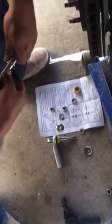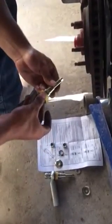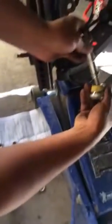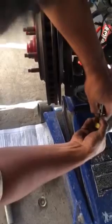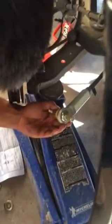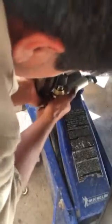So what you do first is you're gonna go ahead and put your 5mm spacer on first, which is these thick ones. You got these thick ones and these thin ones. Put that one first, and then after that you're gonna put your seal on just like this. And then after that you're gonna put it on here. Then it says to put the 5mm spacer, so put that one, and then you put the other one — 2.5mm. And then your nut goes after that.